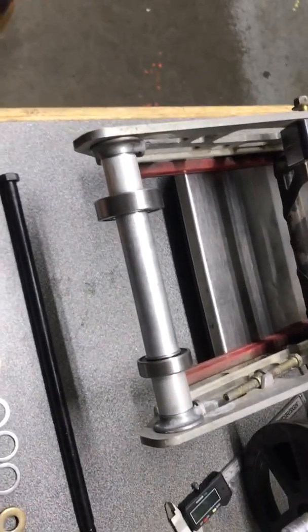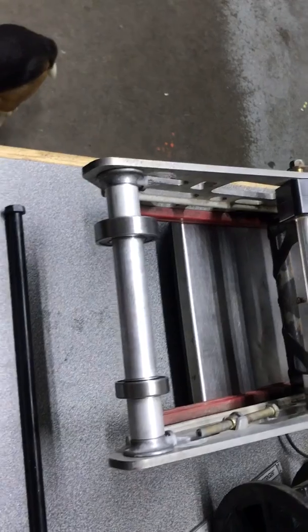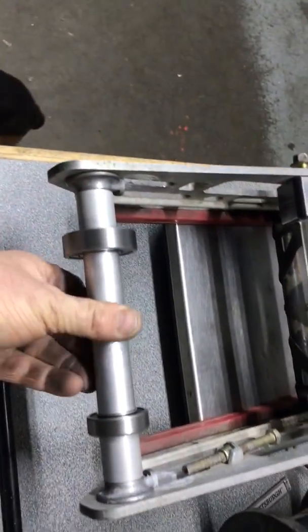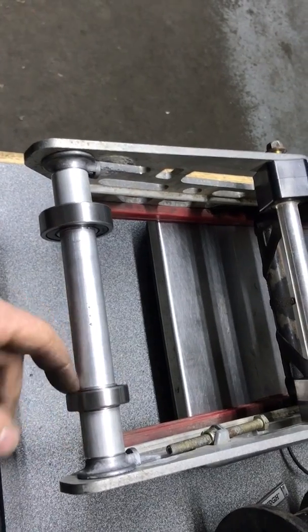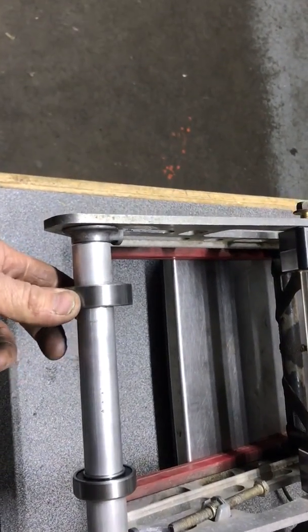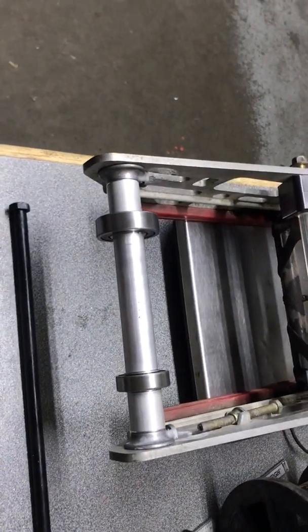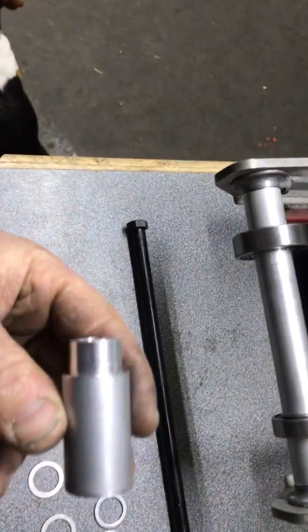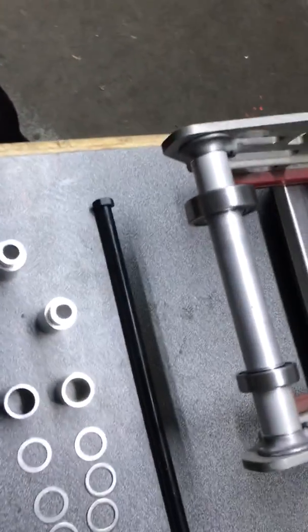When you go to assemble the kit, to remove your stock tri-hub, you're going to want to loosen up one of these bolts so you can spread the rail apart and pull the assembly out. Then you'll proceed to assemble the inside assembly accordingly, again using the shim washers if you have the skinny bearings, and omitting the shim washers if you have the large bearings.